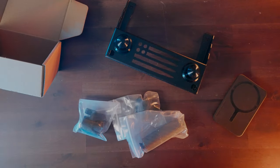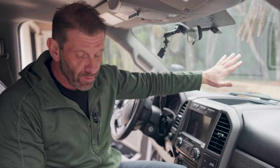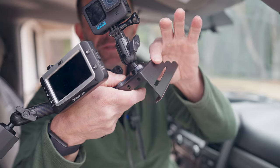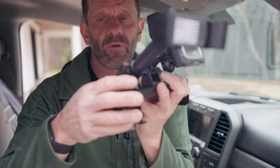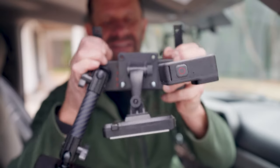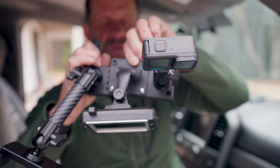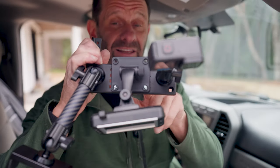Now that we've seen what's here, let's go install it. Installation is pretty simple — really only four screws mounted here. Yes, you are going to be drilling screws into your Ford truck, but it'll make it so much more useful; it's totally worth it. The first thing I suggest is mounting all your devices onto the mounting system and checking to make sure everything lines up exactly so you know where to position it. Mounting onto the system is simple — it comes with the ball joints already there and you just screw these things until they loosen up, put them over the ball joints, and screw them on. For my tire pressure monitoring system, I needed a third-party mounting bracket. It doesn't fit exactly, but it's close enough — I just grabbed a couple screws and screwed it in. Somebody may make one that fits precisely, but this is what I found; there's a link below.